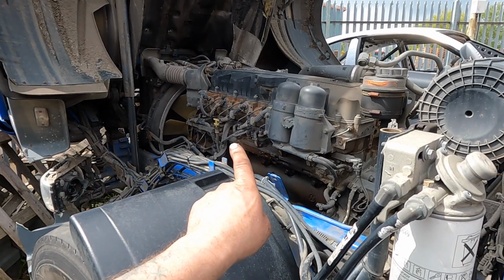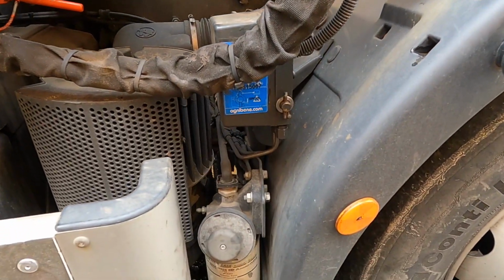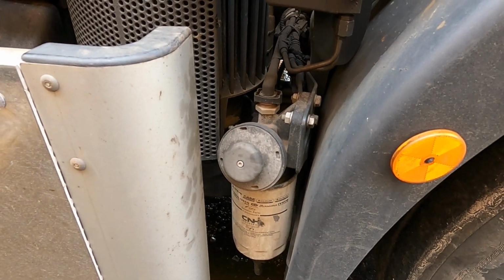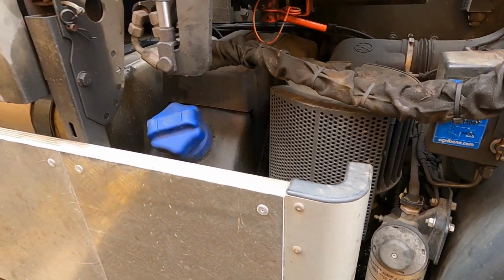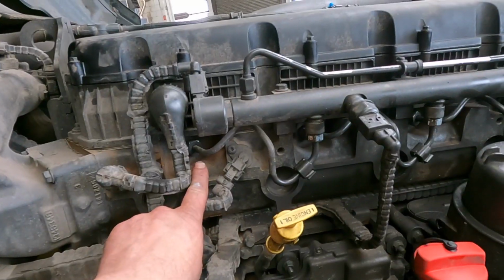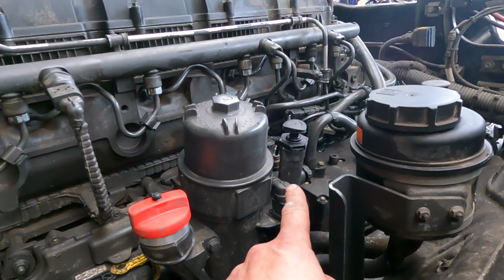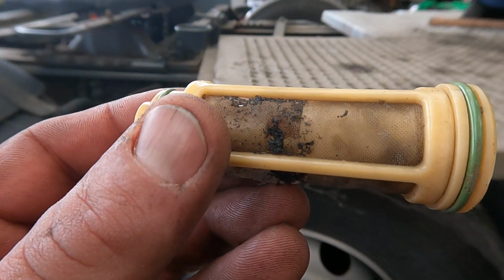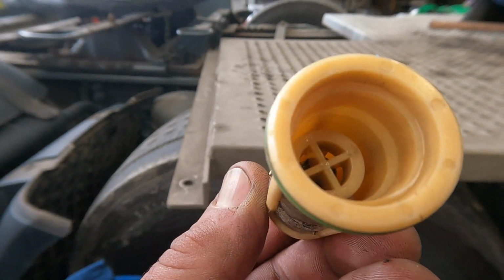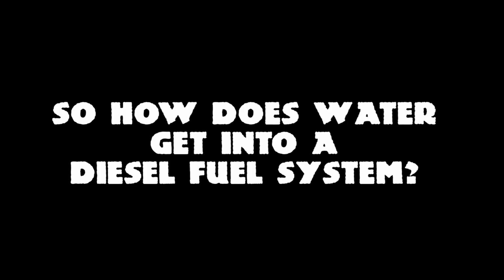Okay, it's actually quite serious business not to get anything up to the injectors or the high pressure pumps. Different vehicles like this Iveco have filters positioned in different areas, and you don't need to crack anything off to prime the system up. You can actually prime it with a handle. The diesel system on this one, on the priming handle, actually has a last chance filter on it, from the primary filter. That will take out any crap and crud that happens to get past that filter, and it does, as you can see here.